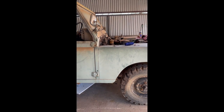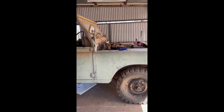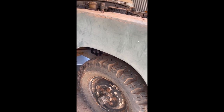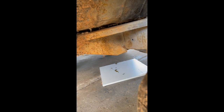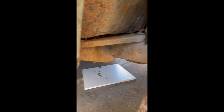Which is why we've entitled this 'The Rover's Return' — a bit of a pun on Coronation Street, but it is the Rover's Return. Wings are straight, body straight, wheels don't look to be too dinked. A set of tyres that were very near these ones were indicated to have been new in 2005. These have got hardly any wear on them but of course they're pretty old tyres now. A lot of surface rust but that's okay, we can deal with that. This part of the floor looks pretty good — just a bit of mud. This chassis outrigger looks pretty good; that part of the chassis looks all right.